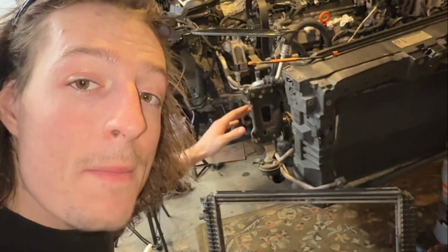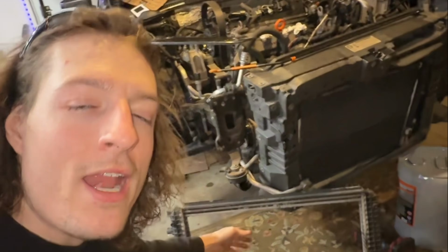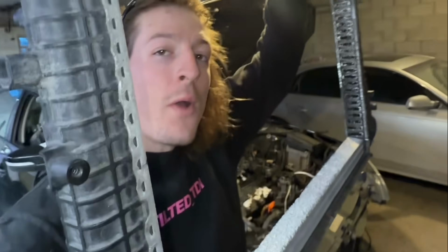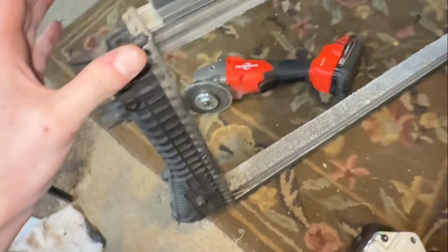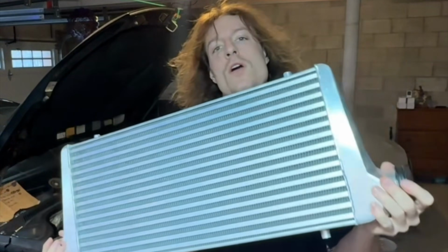Now that I get everything cut out, I'm gonna put it all back together, and when I add the front mount, I reduced the layer, but also added the layer, so everything's gonna flow as if it was stock. Essentially, if I left my stock intercooler and added the layer, things would have heat soaked. Well, this keeps the air flowing straight through, going where it needs to go to the cooling fan. And it is basically just living its life as an air director and a mount.